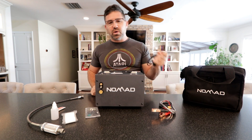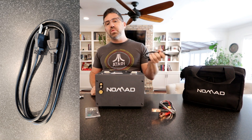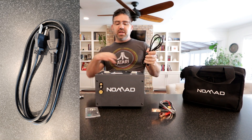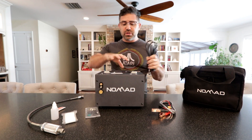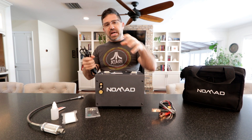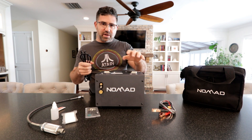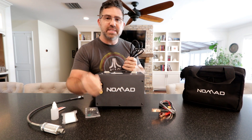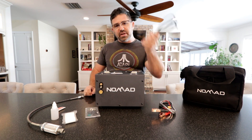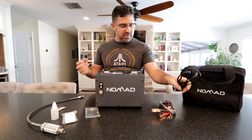Now this is going to work with 110 volt, and it's also going to work with 220 volt. The owner's manual takes you through a process where you remove 12 screws, the cover kind of comes off — you've got to be careful because there are some wires attached to the on-off switches — and then there's a little toggle switch inside that you just flip to convert the unit from 110 volt over to 220 volt.